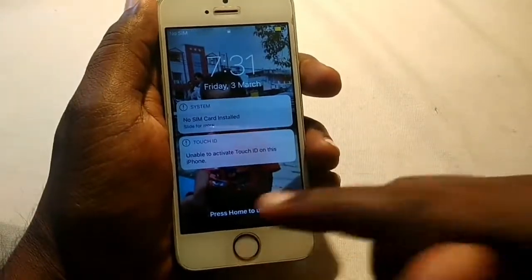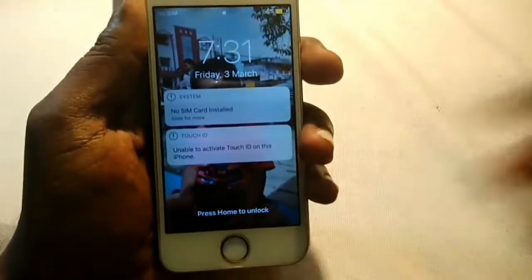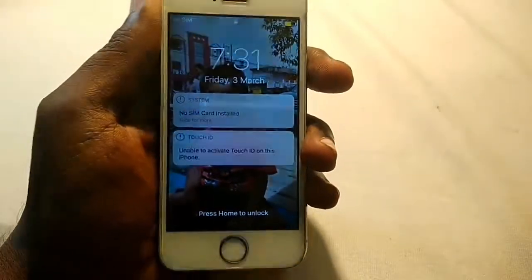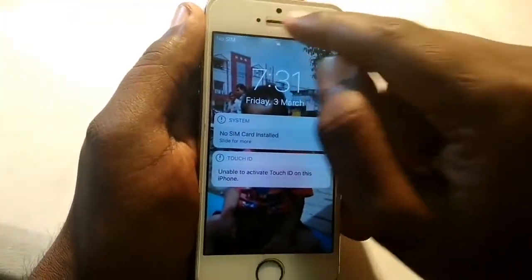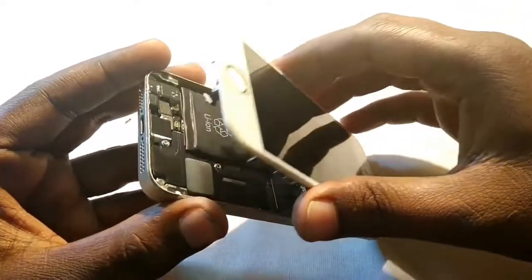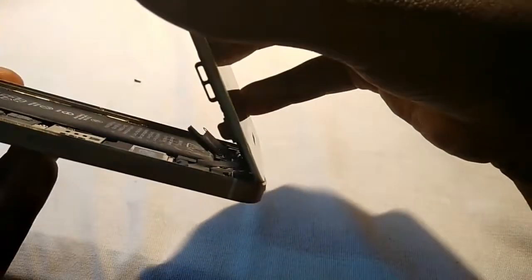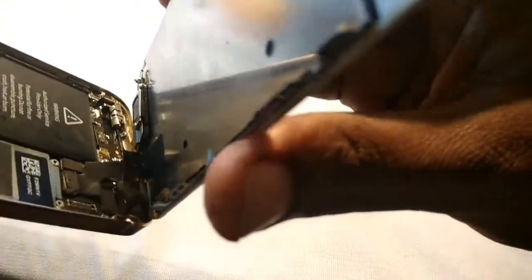So basically this is a problem with the proximity sensor or front camera cable. The front camera, the front proximity sensor and the front speaker are all on the same cable, so just replace that cable and it will definitely work again. Your phone will be working again, and this method will work on all iPhones like iPhone 4s, iPhone 5s, iPhone 6. While removing it, remove it properly. I also gave you a video link in the description to open the iPhone properly. Check out the description.